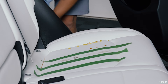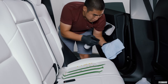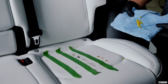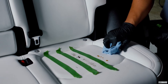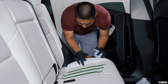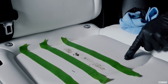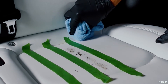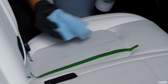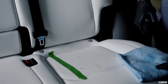Now we're going to start cleaning it up. First, we'll wipe it down with a microfiber and use a little bit of our interior cleaner. Going at the mustard first — already there's a little bit of yellow transfer. The coffee shows a slightly darker hue. I'm not even rubbing or scrubbing hard yet. I'll grab a fresh microfiber so I don't spread contaminants, and now go at the dirt.